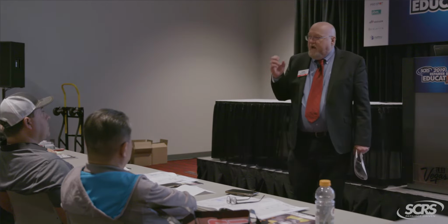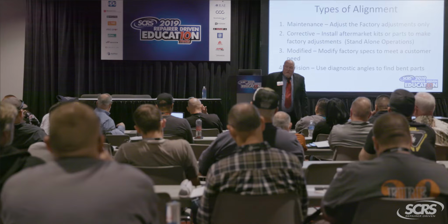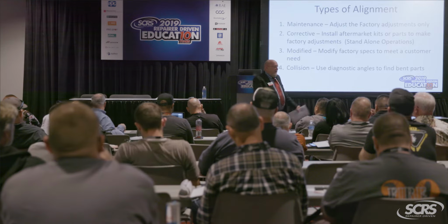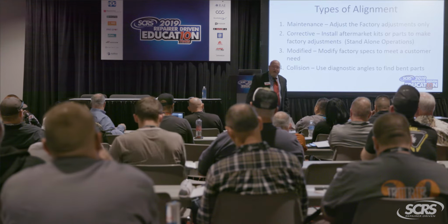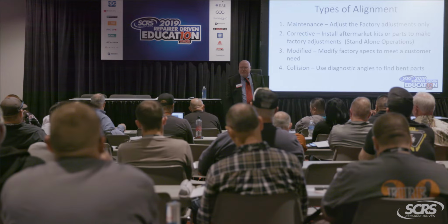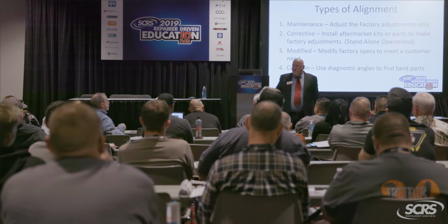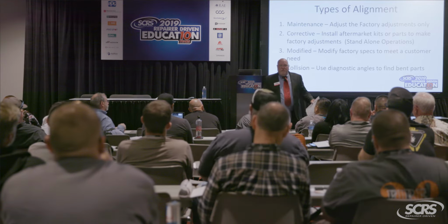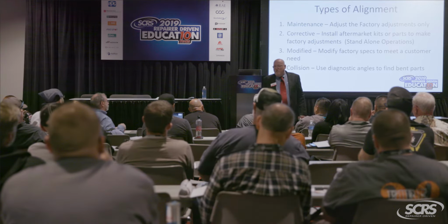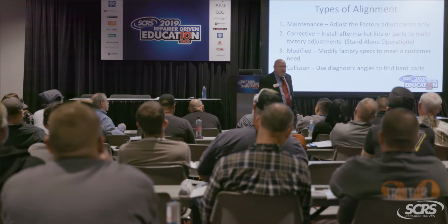And I prided myself on my framework and how I could get things in with that laser beam back in the very early 80s. Okay? I would ship the car off to the alignment shop, and then they would call me back saying, John, your frame's still bent. I'm like, where'd you draw that conclusion? Right? So back the car would come. The angle they couldn't get in was, of course, caster, which we battle with all the time, and camber, of course, but caster was out in this situation here.